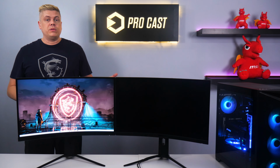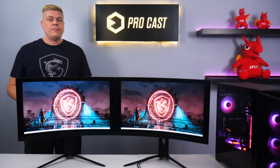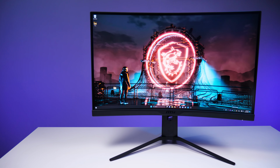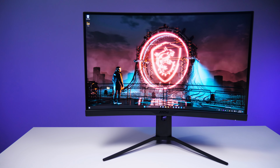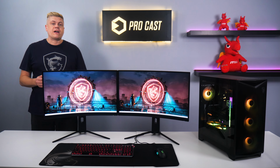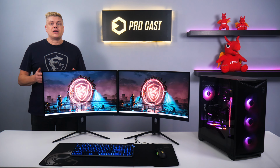With the monitor power cord plugged into a socket, the display may turn on, or press the power button and you may see your PC's desktop. You may need to enable the new monitor, and if you still don't see anything after this, see the section on cables. We should check our resolution and refresh rate to make sure they're correct. Exit any games and stop videos playing before monitor adjustment, or it may reset some display settings.